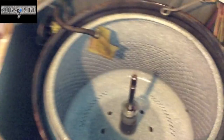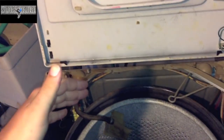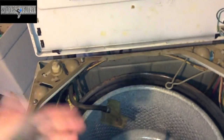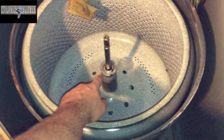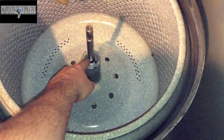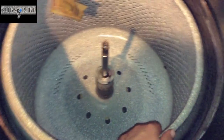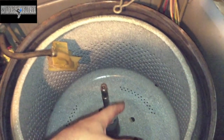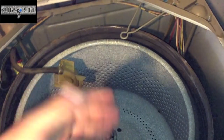I got a mess, I got parts everywhere, but it works. So what I did was I popped the top off - there's a couple of clips. This inside drum is the drum that spins, and this is kind of a bearing of some sort that moves independently. What I did was I took some of that silicone spray, sprayed all around here. This bearing wasn't in bad shape, and I poured a little bit of ATF fluid right down around the edge. Then I took this and it was really stiff, so I physically moved it back and forth two or three times to force the parts to move and coat the surfaces.